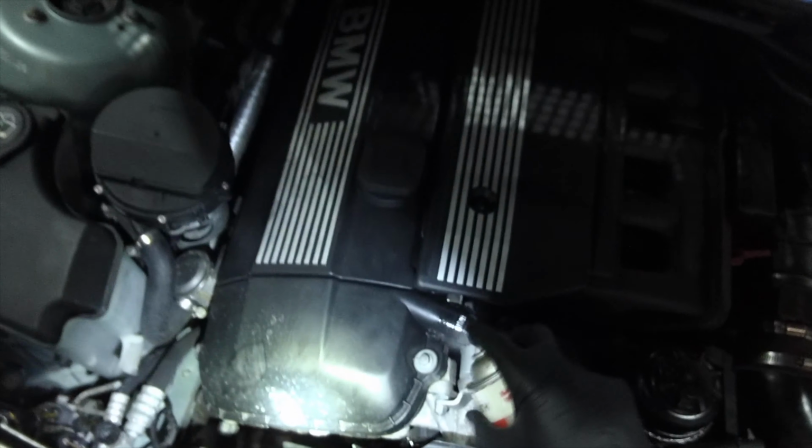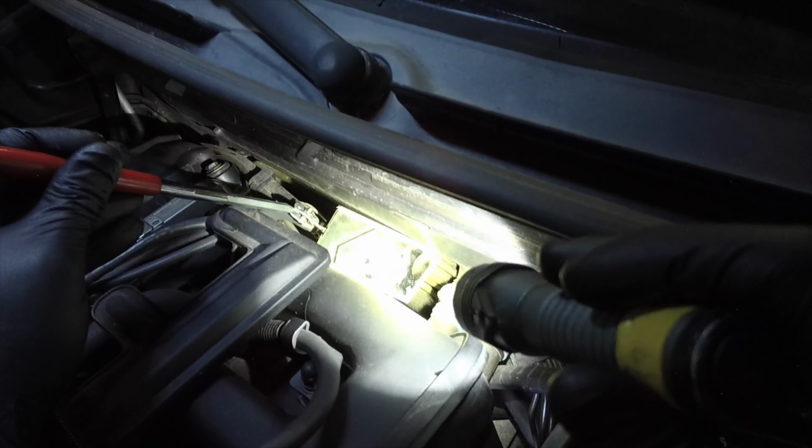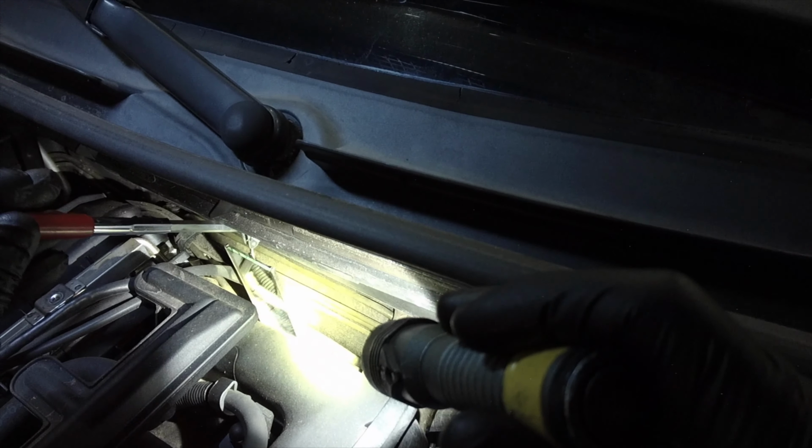Normal for the time being. Makes sense. Also checking the intake runner hose if replaced or damaged. Using a mirror, inspecting the vacuum port plugs and the vacuum lines at the rear of the intake manifold, which have a visual of the vacuum plugs cracking and the vacuum lines dry rotting and deteriorating, which are the vacuum lines used to control the secondary air valve and the rear muffler exhaust flap.